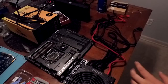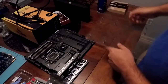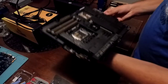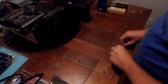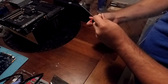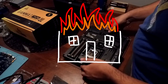I will be taking this slow and steady by testing each of these parts one at a time, starting with the motherboard and CPU. I went ahead and pulled my cheap $30 acrylic test bench out to mount them onto it. I don't want to rebuild this PC yet without knowing what works and what doesn't. Because of its previous state, I'm doing this to avoid a fire erupting in a box. Last thing I need is one bad part burning or destroying all of the good parts of this rig — or my house.